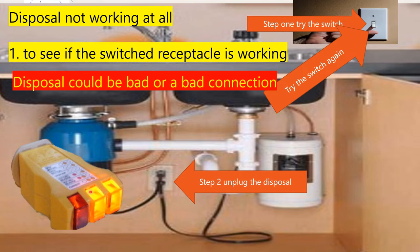Now let's talk about some twilight zone situations you could run into. Let's say you plug this in and you do show correct wiring on the plug tester, but it still doesn't work. One thing you could do is pull an extension cord temporarily from a different circuit over to the disposal and see if it works when you plug it in. If it did, then there's a chance — even though this receptacle reads good wiring — that when you put a load on it, it's broken on the inside or the neutral drops out and it won't work even though it shows correct wiring. But that would be last-case scenario. Before I threw the disposal out, I might pull an extension cord over to a GFCI-protected receptacle, plug it in, and see if it worked. That would be kind of my final check. But if it was old and decrepit, I would probably just call it and throw it away.